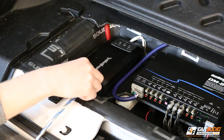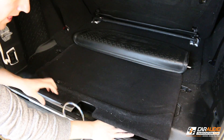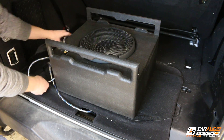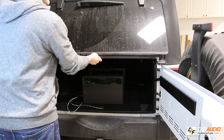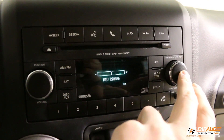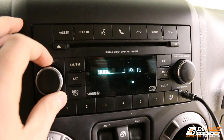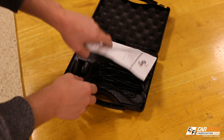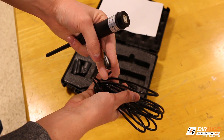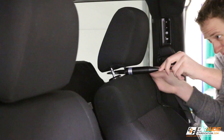To get started, I'm going to connect the subwoofer speaker wires to the amplifier. This is just a test, so I don't need to worry about the path that the wiring will actually run. I can close the lid up above the amplifiers and processor and position my test subwoofer box in place. One of the most important things when setting up a test is to make sure your test conditions are consistent — all doors closed, all seats in the same position, and the radio settings exactly the same, including the volume. I'll be using a Dayton USB microphone for these measurements.